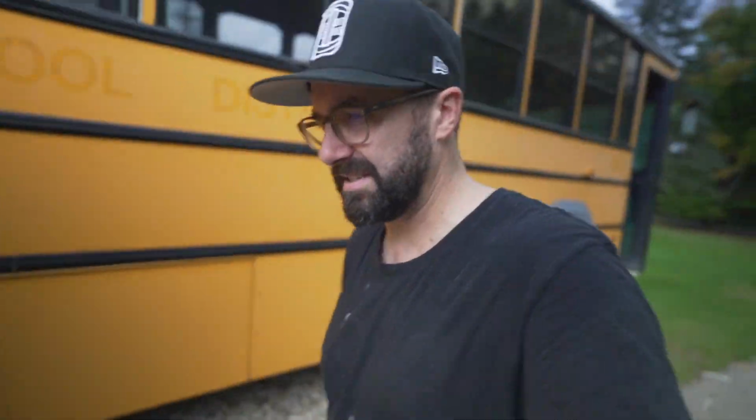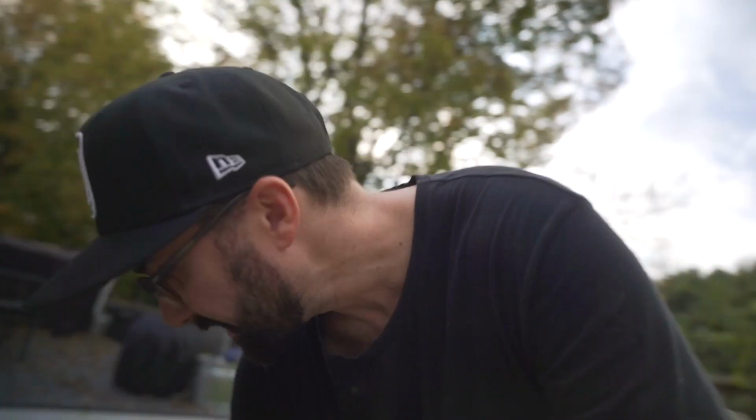So that's good. Gonna jump back up on the roof, like I said, do a little bit of washing, cleaning, let it dry, and then hopefully by tomorrow can start to put on some Enviro White, some Henry's Enviro White, which is what we're using for our actual roof coat, elastomeric but acrylic based, as opposed to the Henry's Tropicool, which a lot of people use, which is awesome, but it's silicone based.